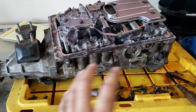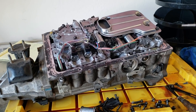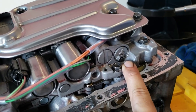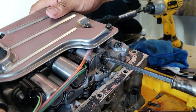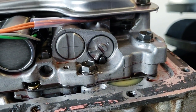Now that you've got the whole valve body and the rest of the transmission assembled, the last thing we need to do is up the line pressure of the transmission so the mods we made can actually be useful. To do that it is super easy — you see this stock screw here. Right now it is in the stock formation. All you've got to do is get a flathead, push it in, and turn it one tooth over, and that is high pressure.